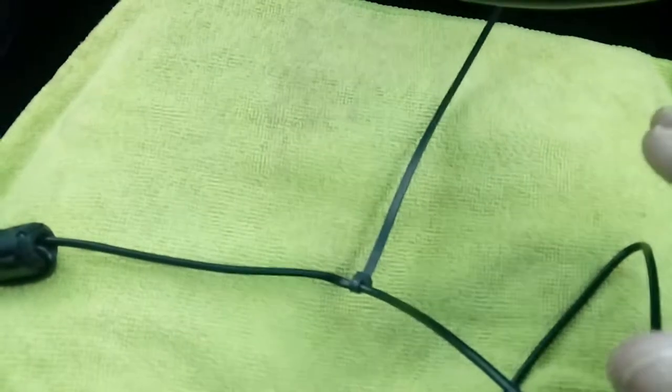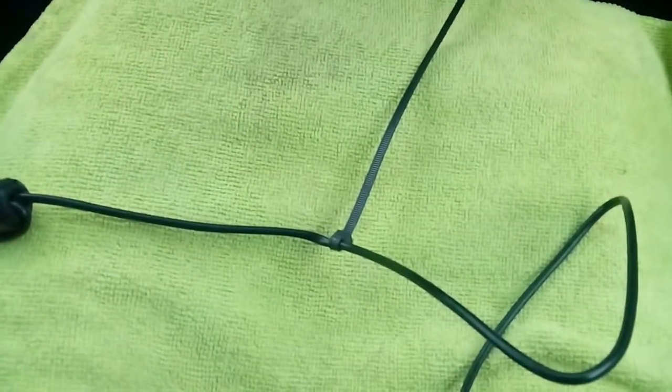So do that and then start mounting your cable up in the roof lining. When you're on the roof lining, get one of your little cable tie areas that you've made, wrap your cable tie around and gently pull down on the headlining. Normally on this particular model of car there's a bit of a gap — it's only a material fiber so you do not need to go at it like a bull in a china shop. Very careful with it — normally you can just put your fingers behind it, pull it, just flex it enough to get your little block in there, and just sort of tuck it carefully.